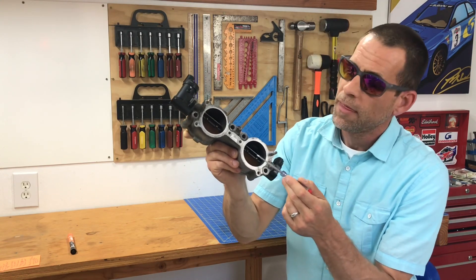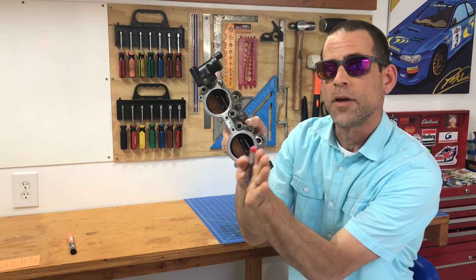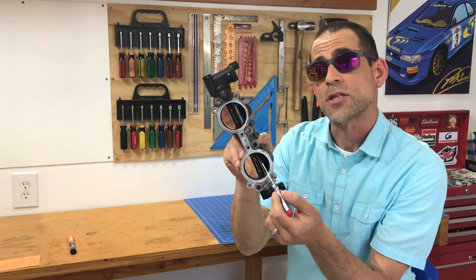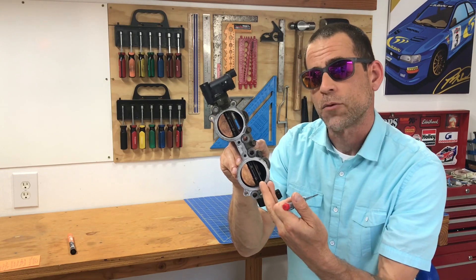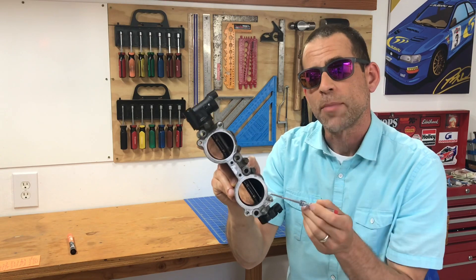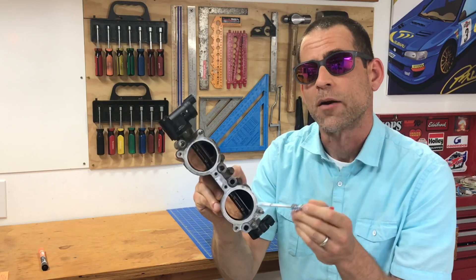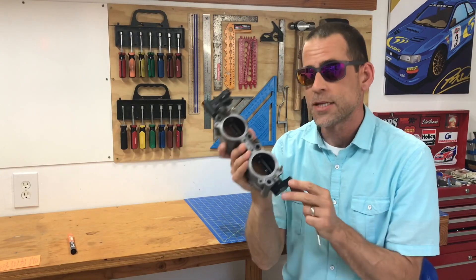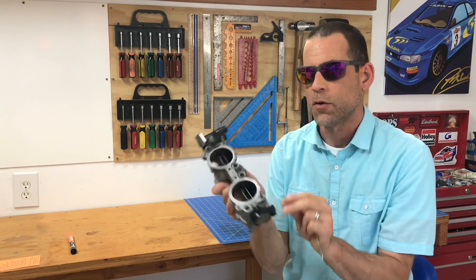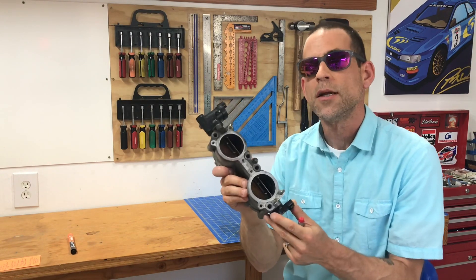Once the engine is up to operating temperature, the butterfly valve actually rotates from that partially closed position to a straight up, fully open position. But the problem is that even when these butterfly valves are in the straight-up position, there's still a lot of obstruction to the air column passing through. If you remove these butterfly valves, these Subaru engines will breathe better, pass more air into the cylinder heads, and as a result make more horsepower. There's another thing to consider: if your vehicle has TGVs and you unplug the sensor, you're going to get a fault code sent to your ECU.